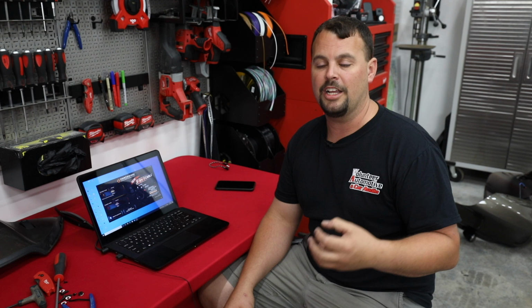It's also going to attenuate the radio down. So when you're hooking an amp up high level in, that's how Precision Power does it with their plug-and-play harnessing. That's how Volunteer Audio builds the Hertz amps that we build with our own plug-and-play harnessing. And that's how many, many other companies do it, that's how Rockford does it, that's how Arc Audio does it, that's how Sounds does it. Just about everybody with any sense is running high level into their amplifiers on a Harley. We get less floor noise, we get less noise from LED lights and electrical noise in the bike by going high level. It's also a more secure connection. We don't have to worry about it coming loose later on like an RCA cable. But anyways, back to this.